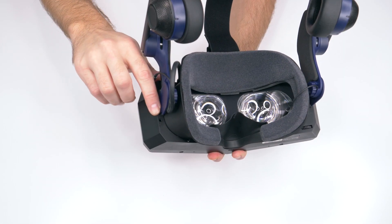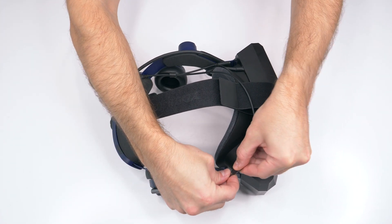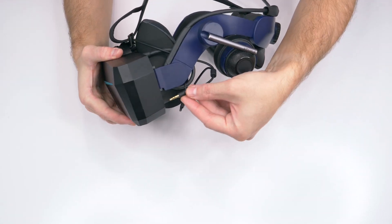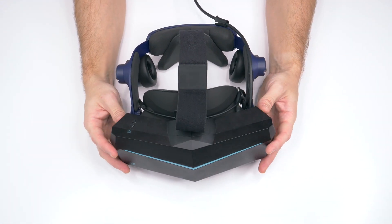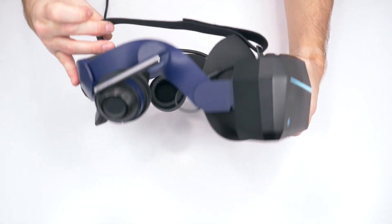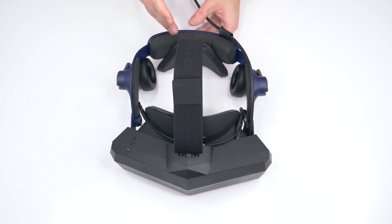The KD Mass is now almost ready. One more thing: connect the audio cables. The Pimax 5K Plus, 5K XR, 8K and some early batches of the Artisan have only one audio input located on the left side, so the included cable adapter is required. Connect the longer end to the right speaker cable, drag it to the other side and connect the shorter end to the left speaker cable. It may not be the most beautiful solution, but with proper cable management it will not look bad at all, and the cables will never be distracting while playing in VR.